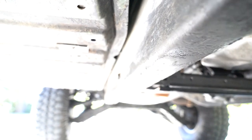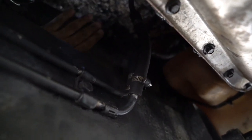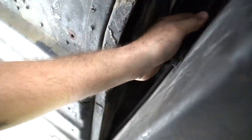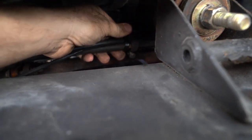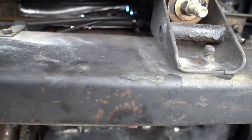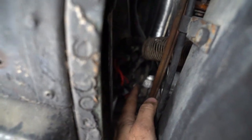Also remember, there are some fuel lines running from the tank along here — you're going to need to unbolt those because they're bolted to the body. One more is up here as well. You're going to want to unbolt these — they're connected to both the body and the frame. Be careful with those and unbolt them. I never had any issues with my electrical wires and cables; they were all okay.